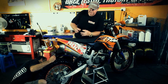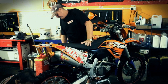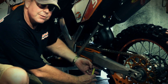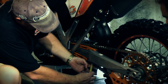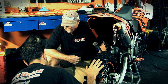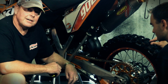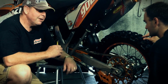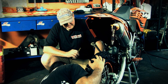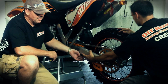It's very important that we align the blocks up equally so that you get the correct drive on the rear wheel. Let's check the tension — what we're looking for is between 8 to 10mm from the bottom of the swing arm to the top of the chain at this position. Exactly right, Vinnie — spot on. Now Vinnie will ensure the axle blocks are equally spaced, marks are lining up, and then tighten up while putting tension on the chain to pull the rear wheel forward to ensure the axle blocks are lined up.